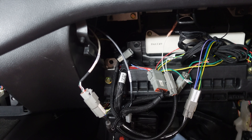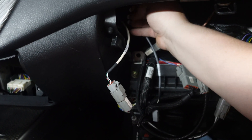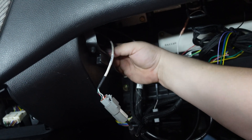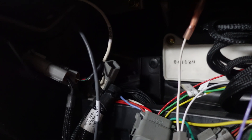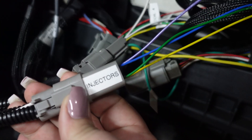We've got the VDM wired through the center console and up through here, and it's sitting right here. This is the two plugs that we just did. We basically unplugged the dash, plugged it into the VDM, and then plugged the ECU into the VDM. So now that the VDM is completely installed, everything is good. We did label everything nice and neatly here, so that's kind of cool.